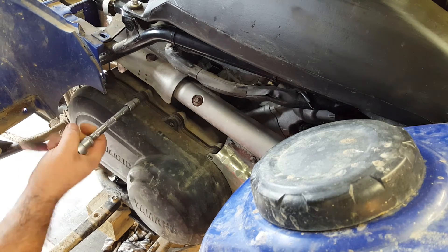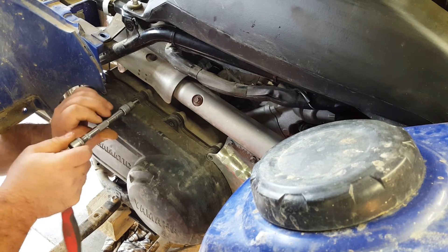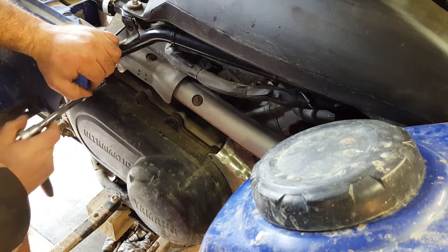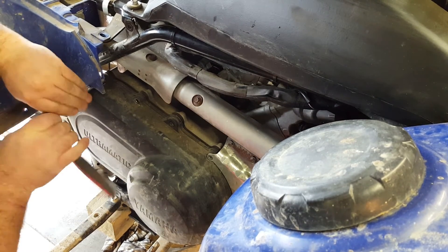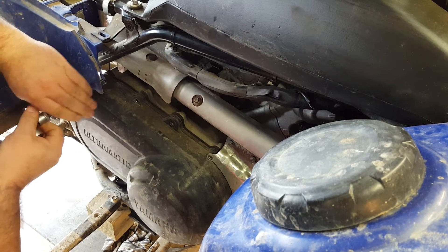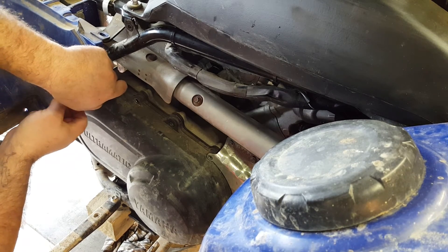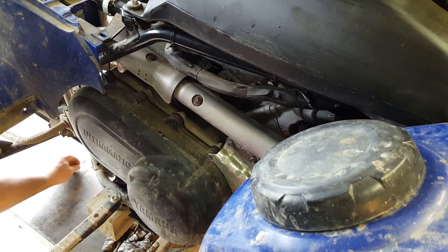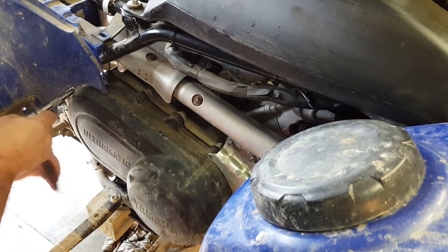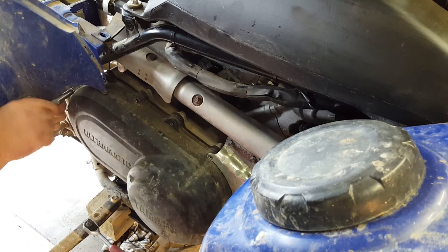I'm pretty confident nobody's been in here since the bike was born — this is the first time this cover will have been taken off. Now if the bike's been used in some really deep water and a really hard environment, then of course we're going to see there may be some contamination of the drive belt and the pulleys. There is a drain down here at the bottom. I've not pulled that — I want to see what's inside first. But you should be draining that maybe once a week if you're running in a harsh environment, just to make sure you get any moisture out. Because if you get moisture on the belt it can cause it to slip, and of course if it slips it's going to wear faster. And of course you're going to lose drive as well — the rider should know when the belt's slipping.